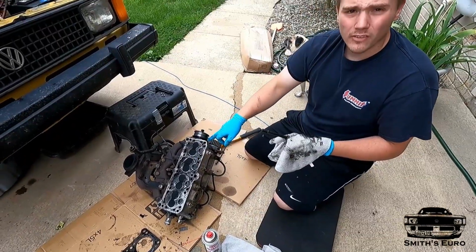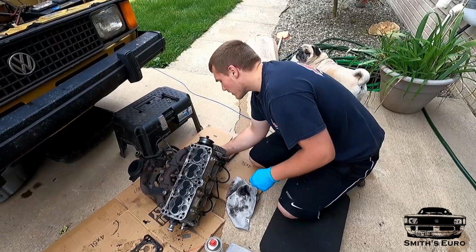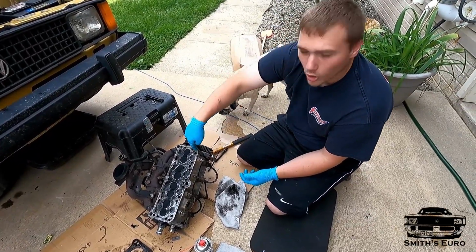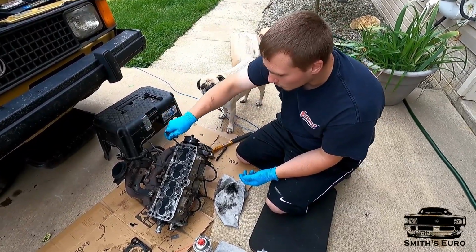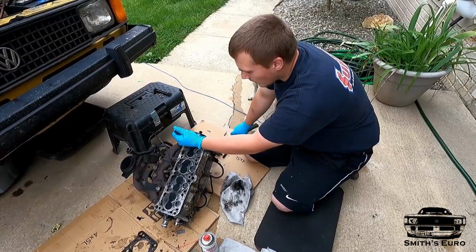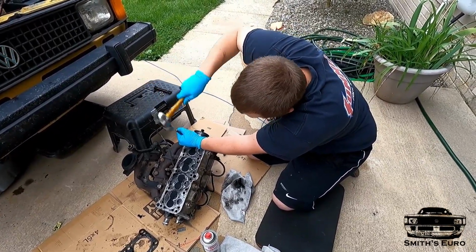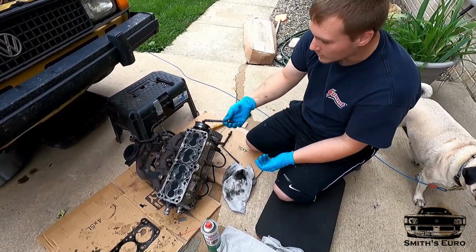The heads come with 11 millimeter holes because that's what normal diesels are. So because of that, you physically cannot get the head studs in, and people drill. You have to open the head holes up, but people don't drill them enough, and that's why these head studs won't come out. You have to physically beat them out like that, because I have to clean the head.